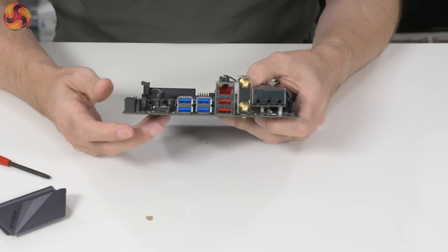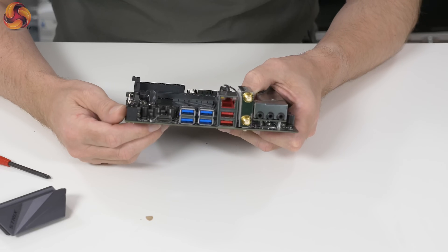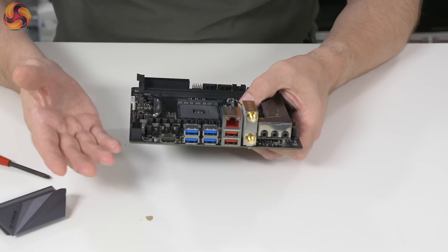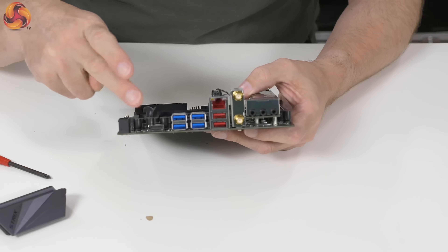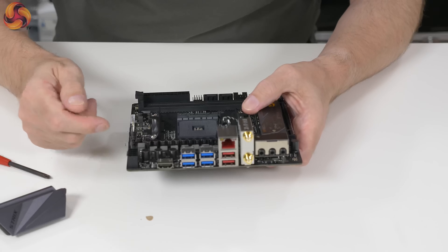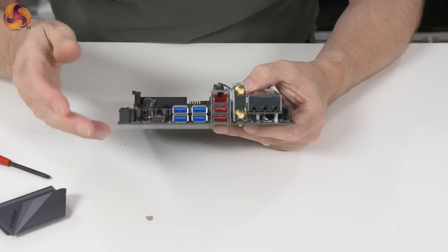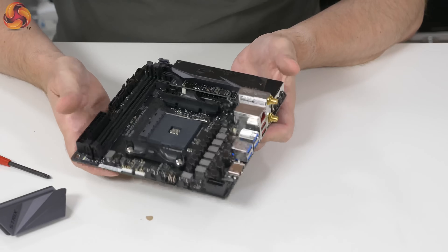This is actually the only visual difference between this board and its previous version, the B350i Gaming — this board has an HDMI output. Amazingly, the B350i did not have HDMI and did not support APU. You can argue that when it launched, the APU hadn't yet come out. But nonetheless ASUS has added HDMI, so therefore this board supports APU. The fact it has a single power phase for the APU and chipset is frankly questionable. My guess is if they were serious, you wouldn't just have HDMI — you'd also have a DisplayPort. If you concentrate on this being a board that supports a CPU, it looks the part.